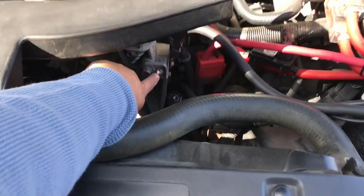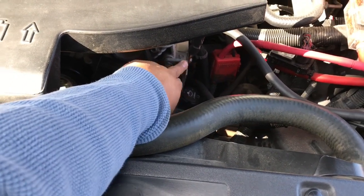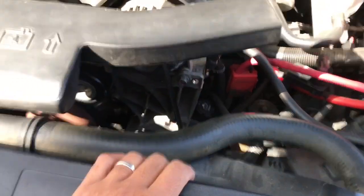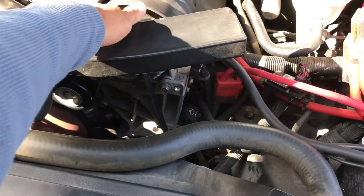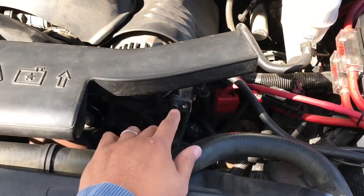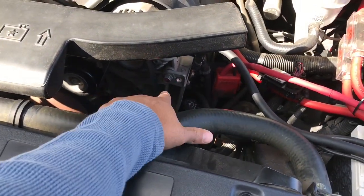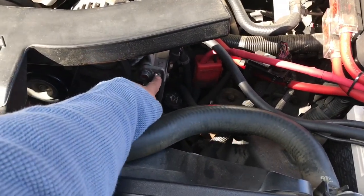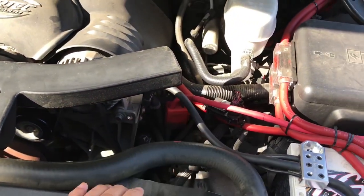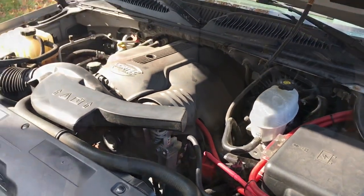And if you see that hole right there, I had drilled that because I was installing my dual alternator bracket. But after speaking with Mechman, I changed my mind. I'm not gonna use a dual alt. I'm gonna try upgrading to the 320 from the 140. That's a 140 stock. Go to the 320, he said I shouldn't have any issues. But if all else fails, I still have my dual alternator bracket. I've drilled my hole so everything lines up. I can put a secondary alternator on if I need it. So we'll get started.